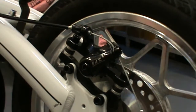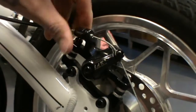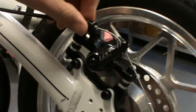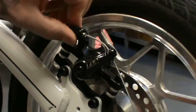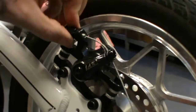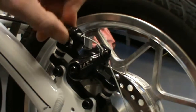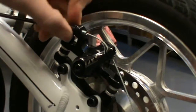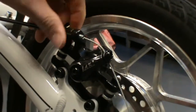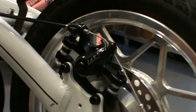Before you tighten any cables, there is a secondary adjuster on the calipers. You want to make sure that's all the way back down to zero as well. Turn this one clockwise until it stops. Check that the adjustment on the brake lever is all the way at zero as well. This one actually had quite a lot on it — a good few turns. You could leave one or two turns in there, just to be sure you can back it off a little bit if needed.